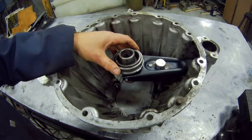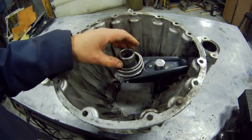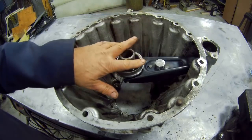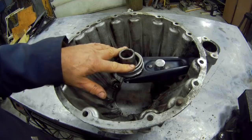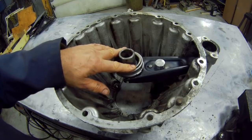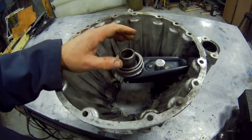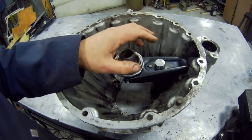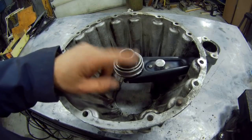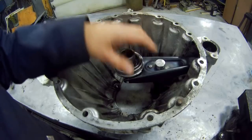The problems we do have is with people who rest their foot on the clutch while driving. This bearing, instead of having just a little bit of contact with no real pressure, will overheat and fail. Never put your foot on the clutch — it's not a foot rest. I've known these bearings to actually melt because they got so hot. All we've done in those cases is taken it out, put a new bearing in with one of my arms, and it's been fine.